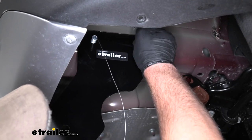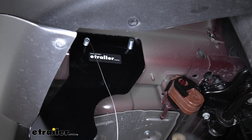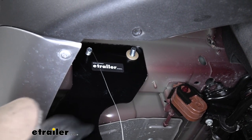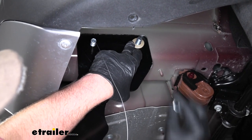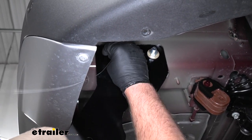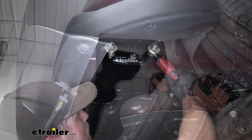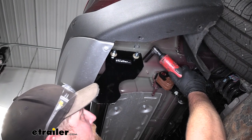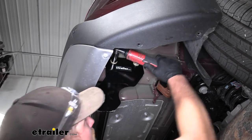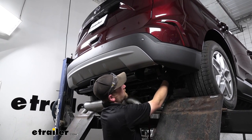Remove one of the pull wires, then take a conical tooth washer — make sure the teeth on the washer are facing towards the hitch — and carefully put it over that bolt. Apply a little side pressure to keep that bolt from moving, take a hex nut, and get it started. Do the same thing for the other attachment point as well. With all the hardware in place and hand tight, come back with a 19 millimeter socket and snug everything down. Once everything's snug, come back with a torque wrench and tighten all hardware to the amount specified in the instructions.